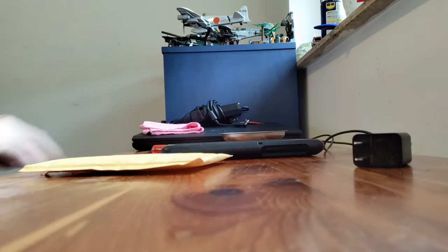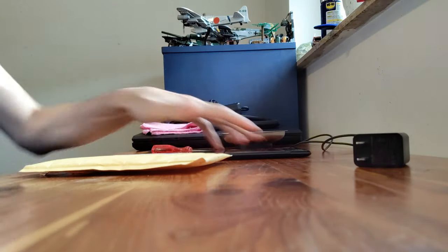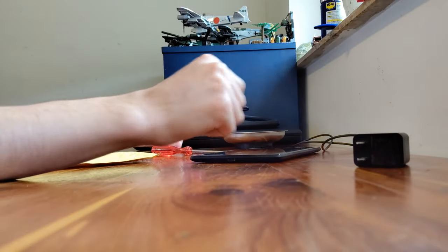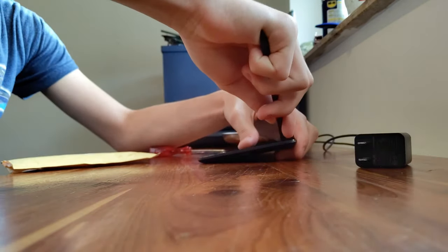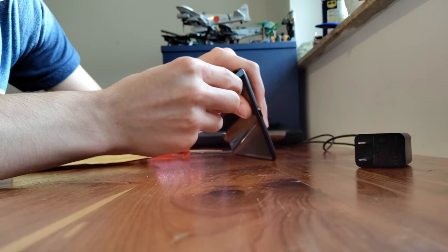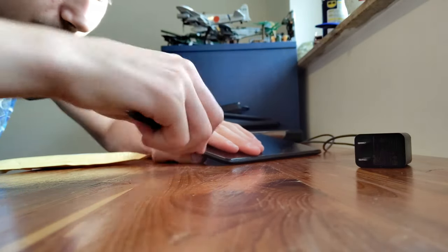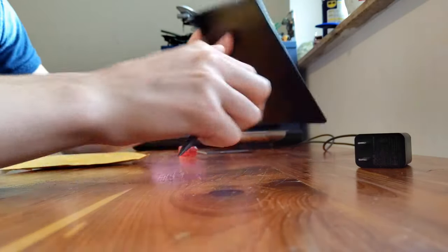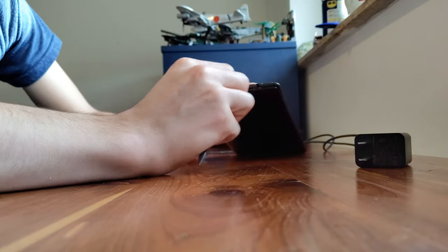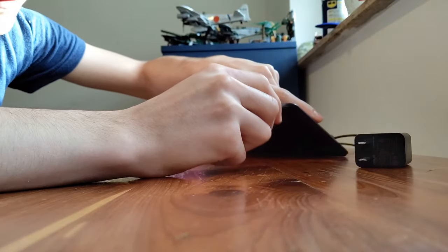The first thing you're going to do is take any cases off the tablet. You should be able to see the back of it. I have a screen protector on there but never mind that. What you need to do is pry all around — if yours has a cracked back casing, that's not a big deal. Find a place near the headphone jack to pry up and release the clips.